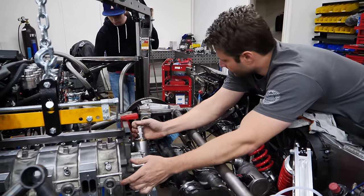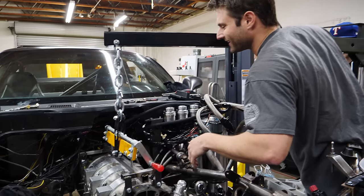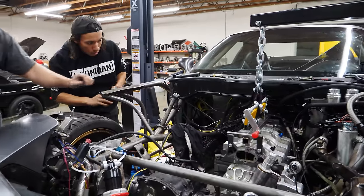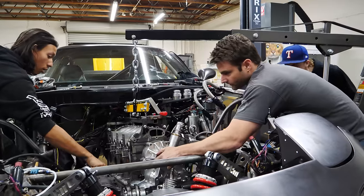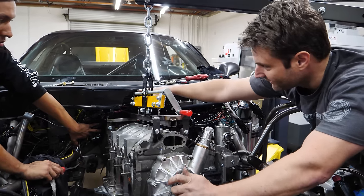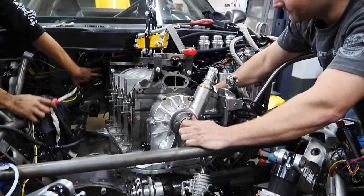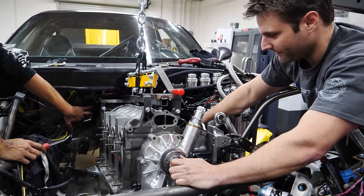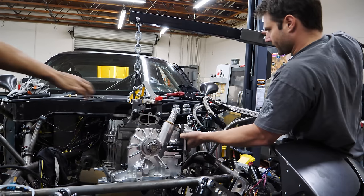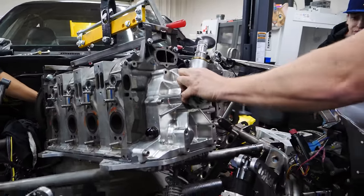The engine is looking good to move forward — just muscle it towards me. The trans piece is off. Pull it forward as it's going up — stop there for a second because we can't go any farther forward. Now we're actually going to pull up like this — okay, crank it away.